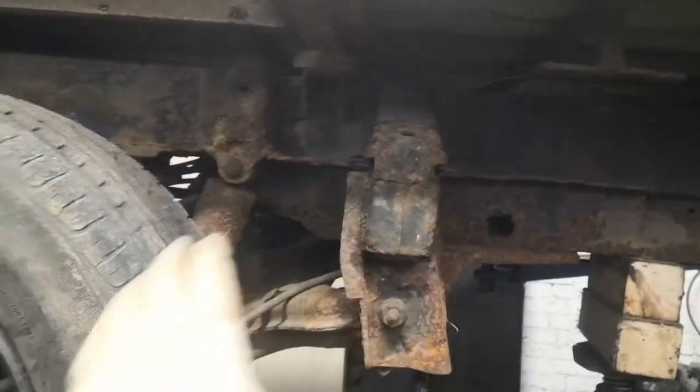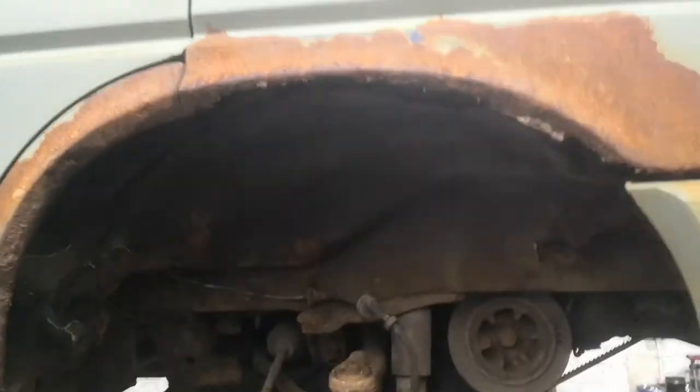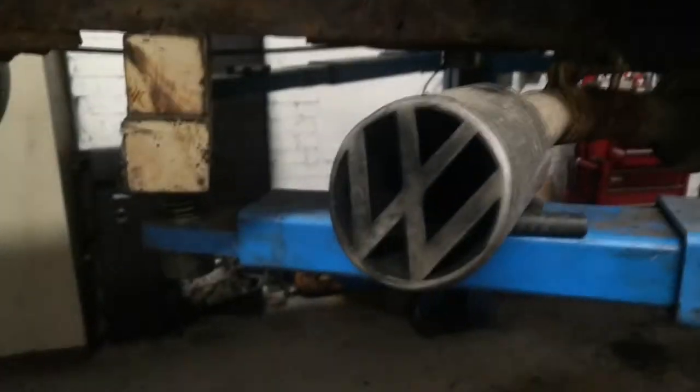First, let me show you the floor — this is everything I've knocked off it. It needs a lot of welding work, but to start with I'm just going to see what's what. I've gone round and prodded any holes in thin metal like that. Most of it in the structural areas is actually alright, and the bottom of the cab's alright. It's just the inner and outer sills, the front inner arches, and the front wings mostly. Some people will say that's a lot of work, and it is, but it'll be worth it. When I jacked it up the jacking point collapsed because it's that rusty.